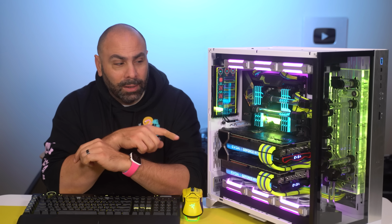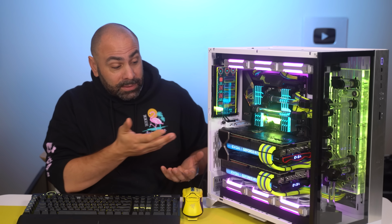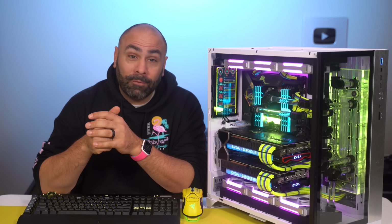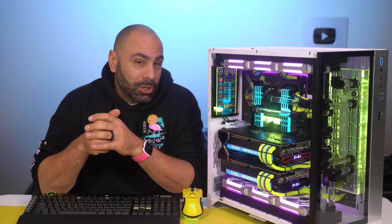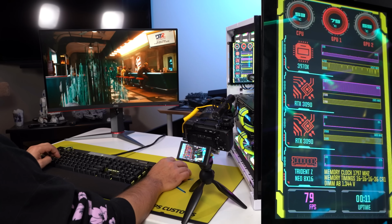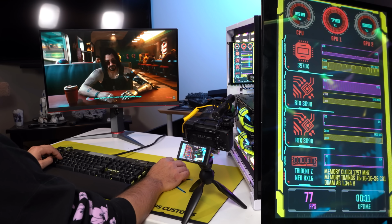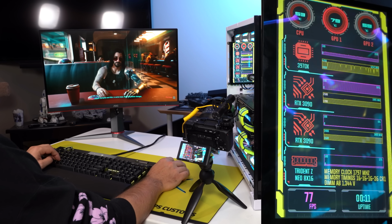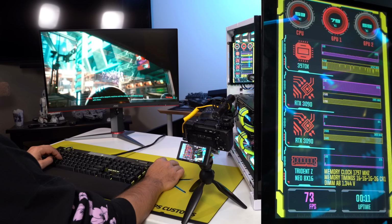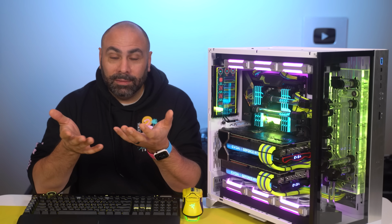This is stupid. While there is definitely still a good amount of allure and mystique to a setup like this, dual RTX 3090s, that's just an absurd amount of graphics horsepower. But functionally, it doesn't really provide any tangible benefit. I ran Cyberpunk, as you guys probably saw, and it was great. One RTX 3090, even though that game is very intense, is still enough to run it at decent settings and have a great experience. And adding the second one does literally nothing in that game.